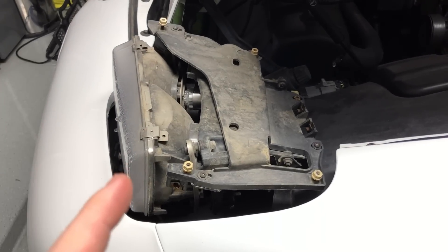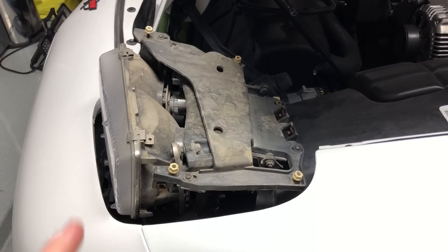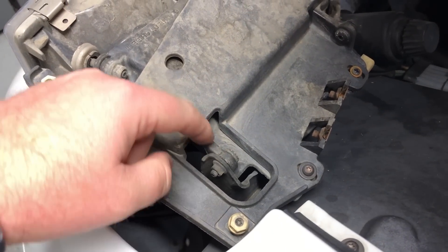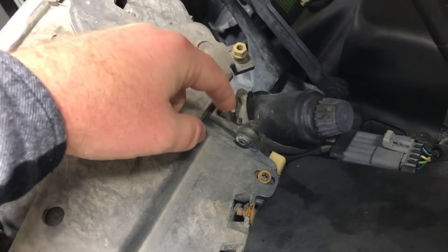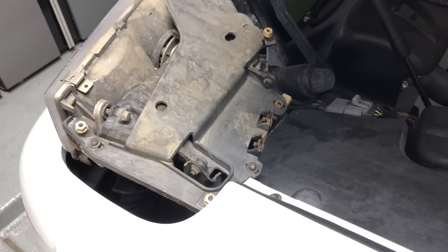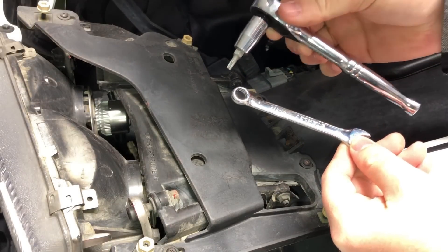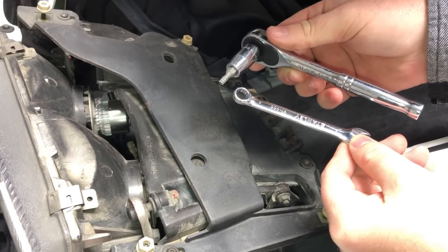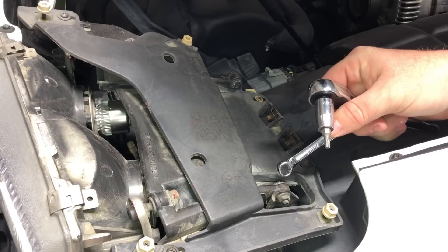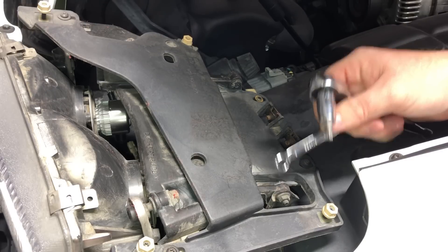To do this properly and much easier it's best to take out the whole headlight assembly. The first step is undoing the bolts right here — there's a screw and a bolt on each side, both with a Torx head. You're going to need a small 8mm wrench and a T20 bit on a small ratchet. There's a good chance there's loctite on these so they're going to be pretty tight — be careful not to smash your knuckles or strip the threads.